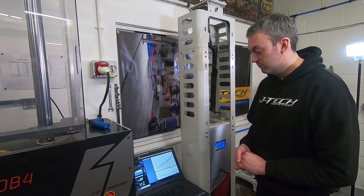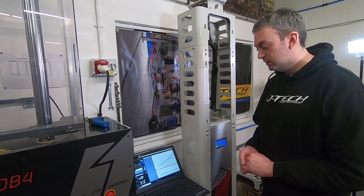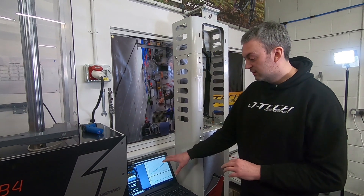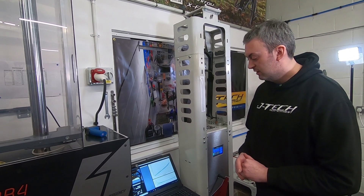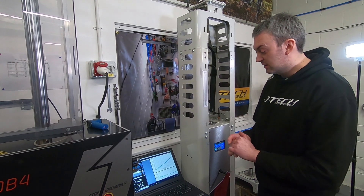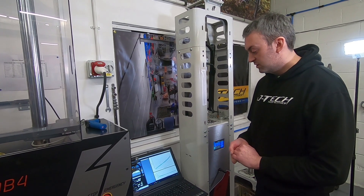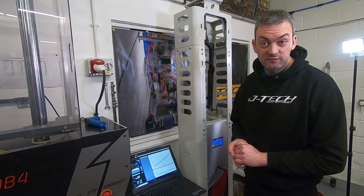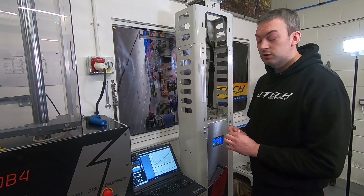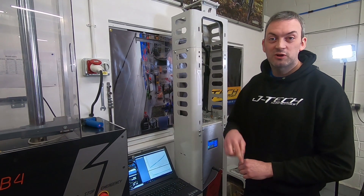That's why we pretty much always recommend the coil fork over the air. The only time we'd recommend the air is if you want a lighter weight fork, or if you want to set it up more progressive — the fork we've tested here is set up to an average amount of progression for an 80 kilogram rider as per Ohlins recommendations. It can be set up slightly more or less progressive, but we'd only really recommend the air fork over the coil if you wanted more progression or a lighter weight fork. Coil is the way to go otherwise. Thanks for watching — don't forget to like and subscribe, and we'll see you next time.